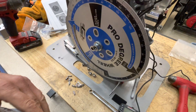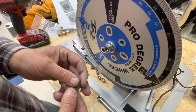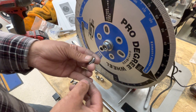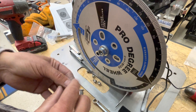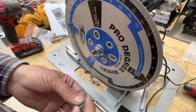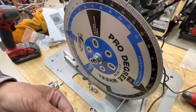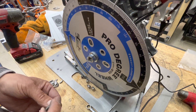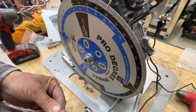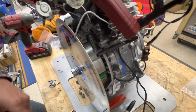Now tell them what happened in North Carolina — for all our haters. The key that we had when we took the flywheel off — this is why I know so much about timing — they DQ'd me and then publicly humiliated me, or tried to anyway, calling me a cheater and a liar. And this is kids racing. The key fell out. I didn't know which way it went in. I put it back in, put the flywheel back on. Naturally I had a 50/50 shot of getting the key back in the right direction because there's no marking on a custom ground key. It's kind of like flipping a coin. We put it back in, we were wrong. I didn't know how to check timing, we went to the race, they DQ'd us. The car was naturally faster. They publicly humiliated us and then DQ'd us — and that was fun for kids racing.